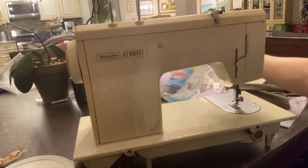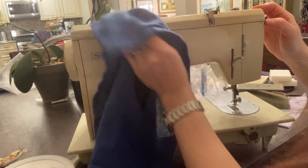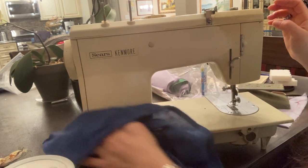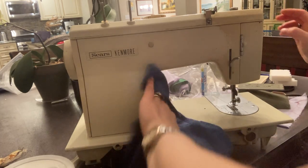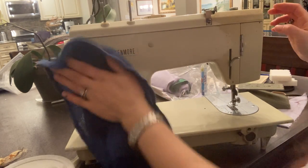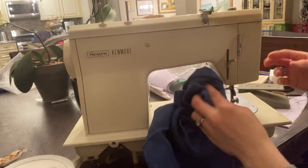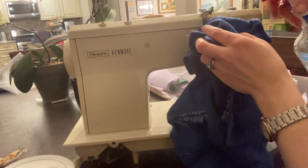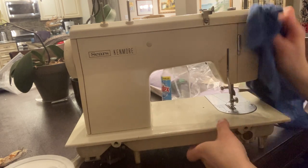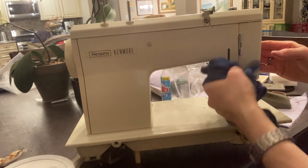What I do use after I'm done — if you have stickers on it, some stickers act like they're permanent. My wonderful trick: take a towel and soak it with WD-40. WD-40 will remove paint off pants and things like that, but it's really good at removing stickers. If spraying and rubbing doesn't work, soak a paper towel in WD-40, cover the sticker completely, leave it overnight, then come back the next day and use a magic eraser to rub it off. It works like magic — even really old duct tape remnants.